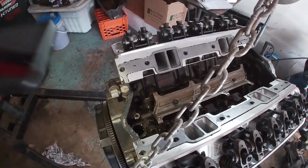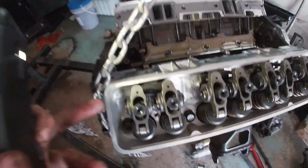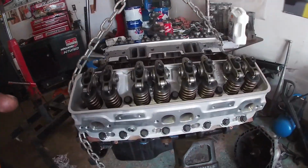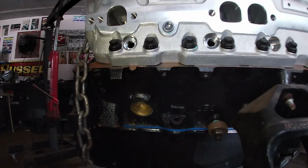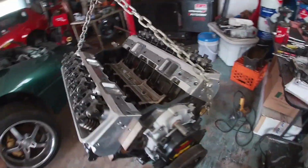So my dad's actually bringing me a distributor. I'm going to set it in there, and then we're going to turn the oil pump and prime the system before I even go and try to set these back at zero. Because obviously, they never ran this motor. They never had it on an engine dyno because the oil pan was empty. So I'm just waiting for that to show up, and I'll show you how to do that.